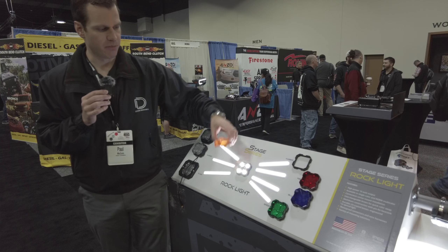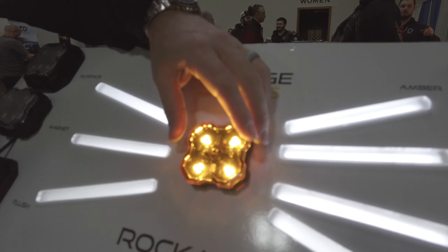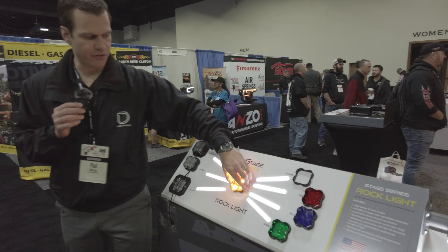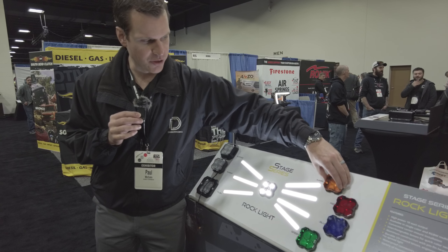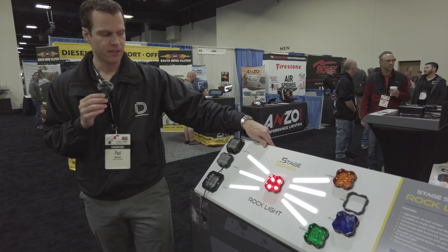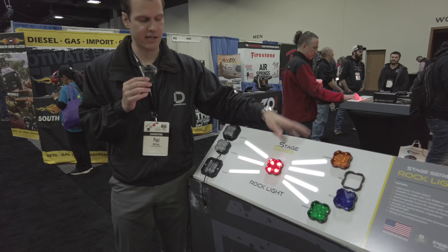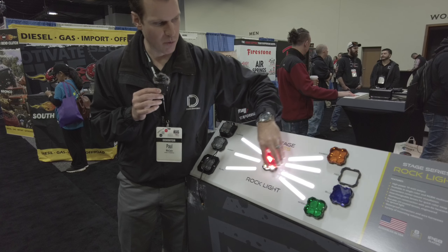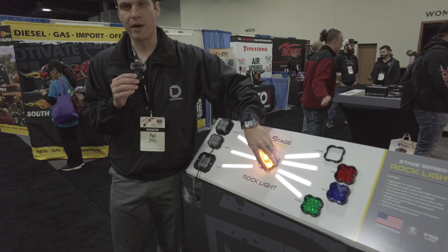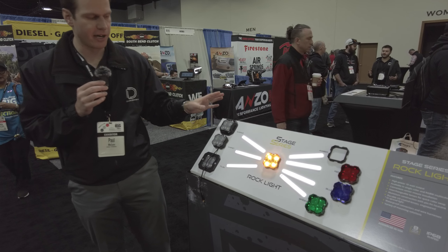From there, you can go ahead and put your lenses on top to complete that appearance, whether it's a clear one to get your white or to get your different colors. One nice thing about these as well is that if you have the red on there, it becomes extra useful because this is a three wire system. We have a low and high power wire. So whether you have extra red light on the rear of your off-road rig running and then brake tied into that, or you just have your amber or white set up as a scene light for the campsite, you might just want to turn that to the lower power mode. Maybe you don't need this full 1,000 lumens of output from that white — it's really, really bright when fully on.